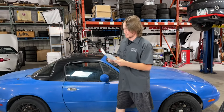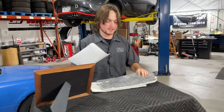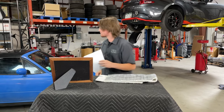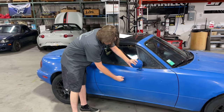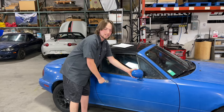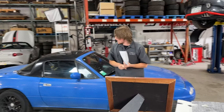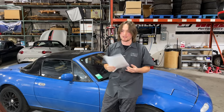Sometimes weight is a good thing for comfort. Adding in something like our DEI insulation kit — this kind of material — can damp a lot of vibrations or sounds. You can put some of this sticky material right in your door panels on the flat parts, and you'll get a more solid-sounding door. You can also put insulation in the chassis of the car — the flat, non-ribbed parts are best — like the transmission tunnel.